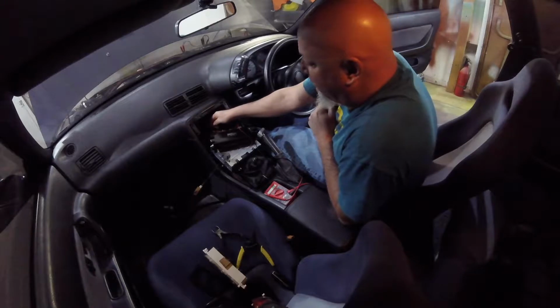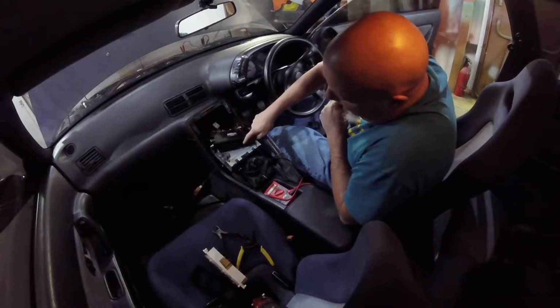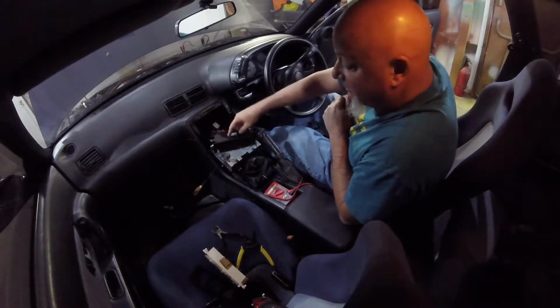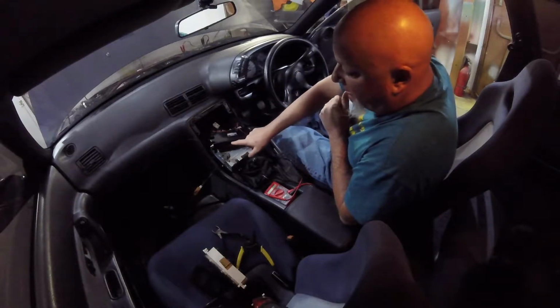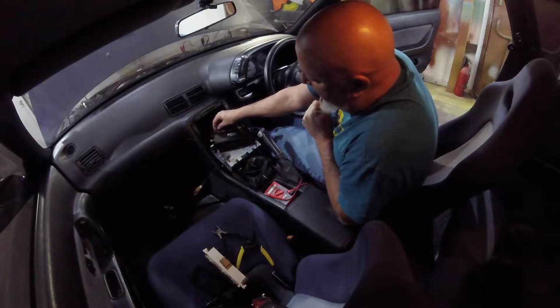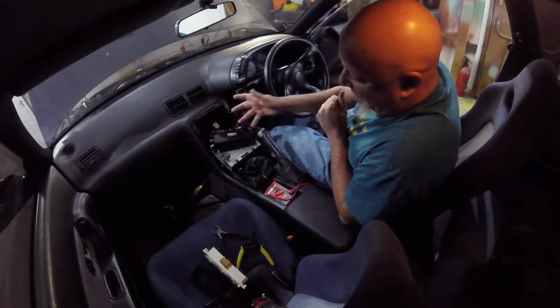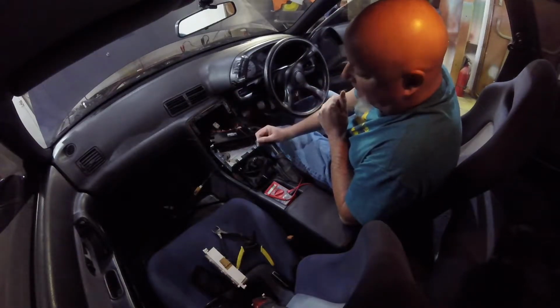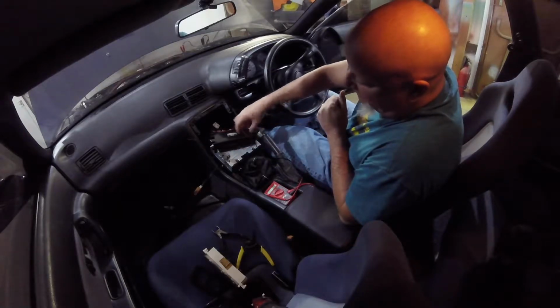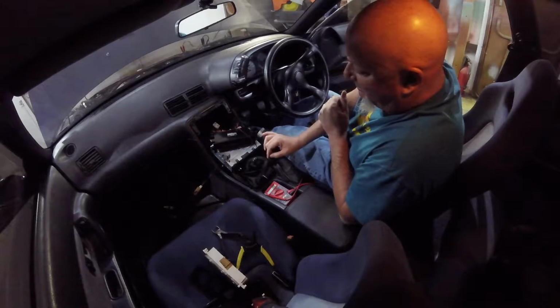wire, the lead that comes from the headlight switch that feeds power to the blue LEDs also dims the screen right here. So there's something going on that if you use the ignition wire off of this module and connect it straight to that, it acts funny. I don't know why. It must be something inside, because this module starts flashing and the fan kicks on and all kinds of weird things start going on with it.